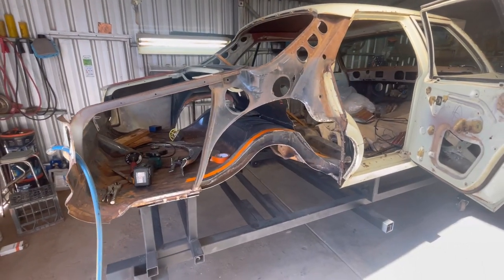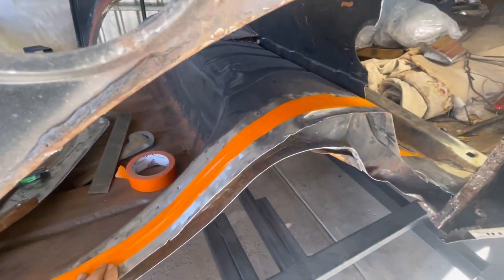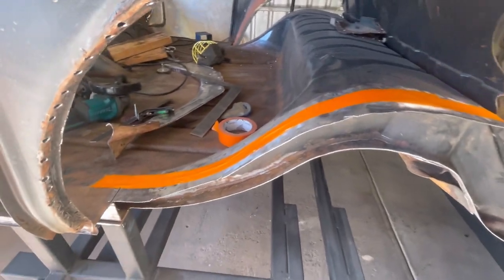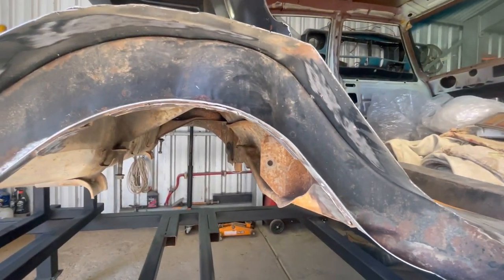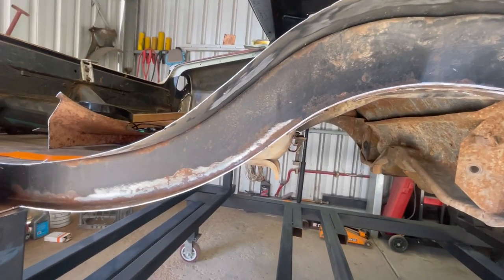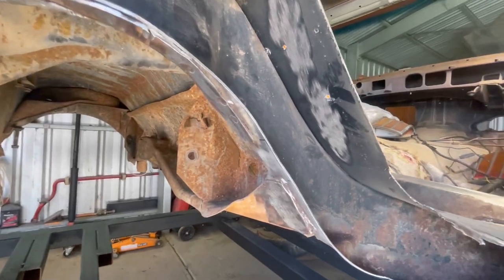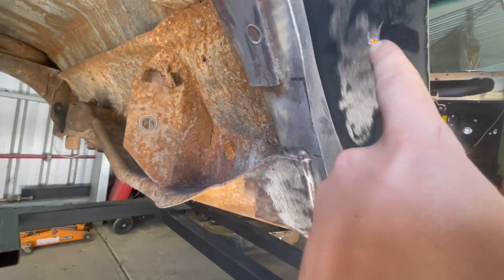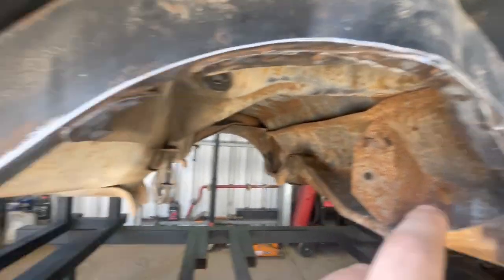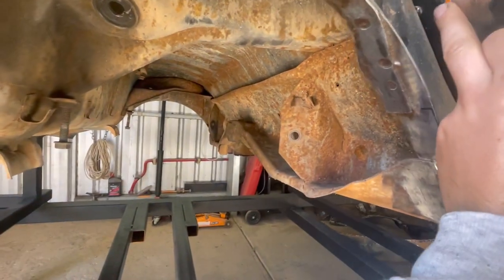All right, so I've got the floor pan all marked out. The approach I took on this, I've sort of taken a page from John Dodge, or one of the Dodge brothers, I think that's what his name was. If you want to find an easy way to do something, get a lazy man to try and do it. So what I did was I basically just measured up from this point here and drilled a few 1/8 holes in a few spots.